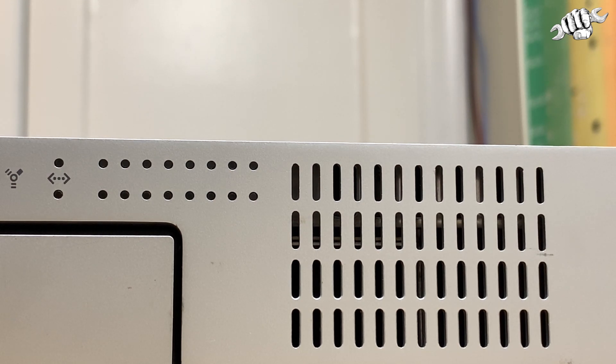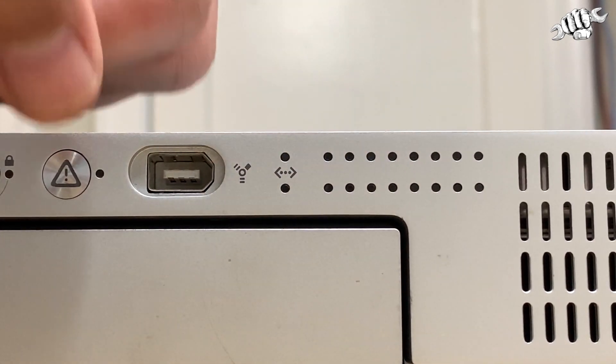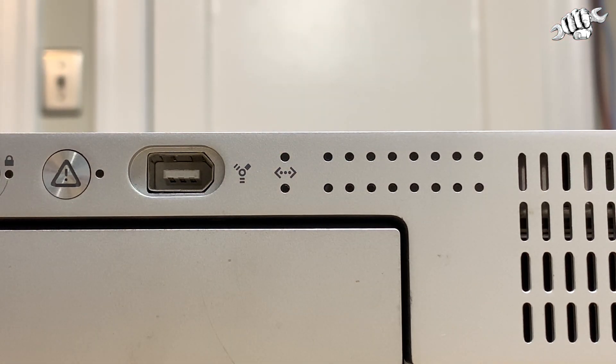On all the servers, selecting one of the options is the same: once you've made your selection, hold the System Identifier button down until all the lights turn solid, and it'll boot up in that mode. This might come in handy if you don't have a mouse and keyboard and you need to do target disk mode quickly, or if you need to boot from a CD-ROM or DVD installer without a keyboard to hold down the C key, or if you need to do an NVRAM reset or use diagnostic mode. Hopefully this will come in handy for you at some point — let me know in the comments. See you next time!